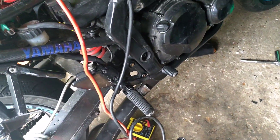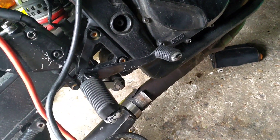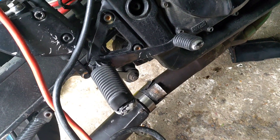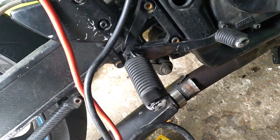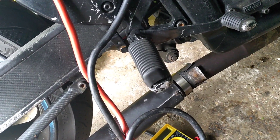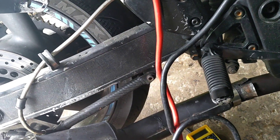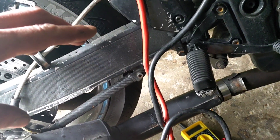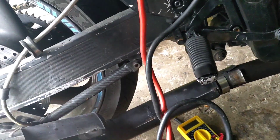For next week, I've ordered an exhaust and I'm bidding on another. This kind of harks back to when sorting out Sultan's ER5 café racer on Motorcycle Rescuer - they made the mistake of just going for a cheap tag-on that didn't quite work and looked a bit crap. So I've ordered a cheap slash-cut one just to see how it looks and sounds, and to give it some back pressure. I've also bid on a full system. I'll see whether the slash one works or whether I need to buy a link pipe to get that pipe to a decent angle.